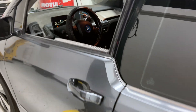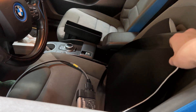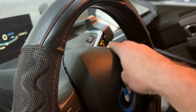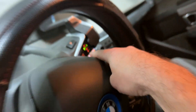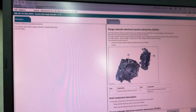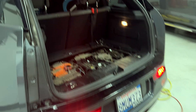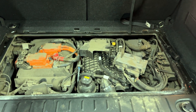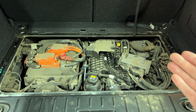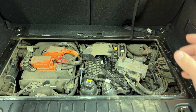We're going to do a test run on this engine just to show you what's going on. There are some prerequisites: the door needs to be closed, the seatbelt needs to be buckled, the brake has to be depressed, and the ignition switch has to be cycled. It's ready to go. It's going to try to start right now — it's working, but then it shuts off. Something shuts it off and stores that fault code.